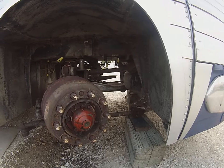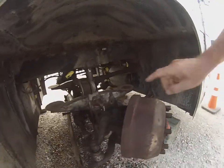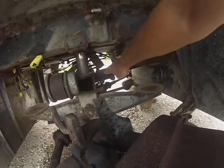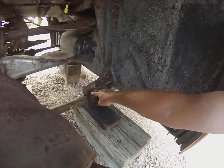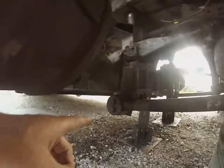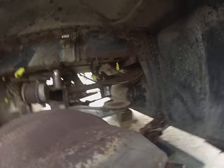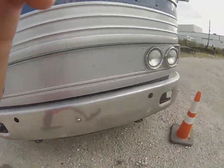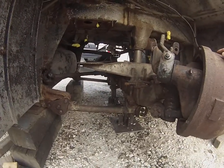That's really important. Really the only thing that can happen that would make this job bad is if you break off one of the bolts that go into the blocks, which would be these guys, those down there, this on the other side of here. Those go into blind holes. Unlike these bolts here, which are through bolts, you could always cut those off and replace them. Through bolts there, and then on the other side. But if one of these guys here breaks off, that turns the job into a nightmare. So a lot of penetrating oil, being careful with your impact wrench front to back, kind of loosening the bolts. We were very, very fortunate in that we had no bolts that were stuck. They all came out fairly easily.